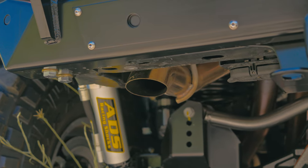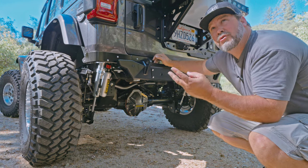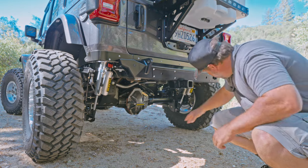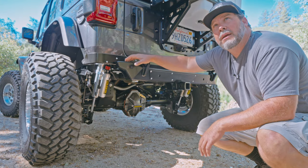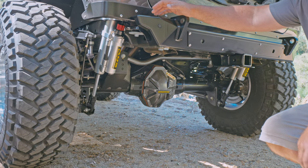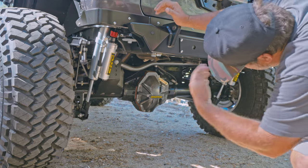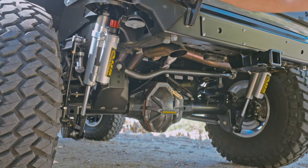We did a Magnaflow Catback rock crawler kit they sell. And that's a true dual exhaust still, like the factory. And here's one tailpipe here and one here. So it's 2 3/4 all the way to the back. Yes. And it relocates the muffler up underneath basically where the factory cross pipe was. Yeah, right up in that area. And then with the Motobuilt skids, the skid plates actually protect the muffler underneath there, which is pretty cool.